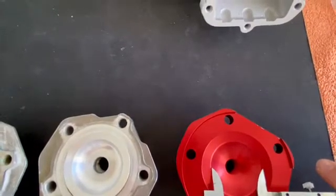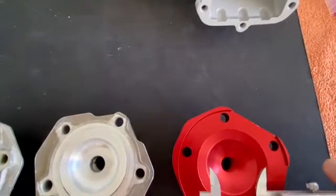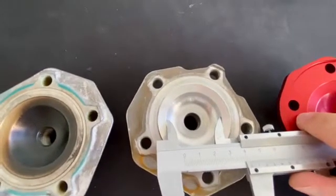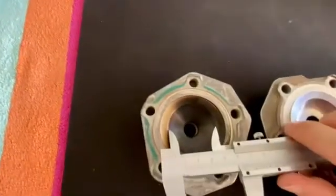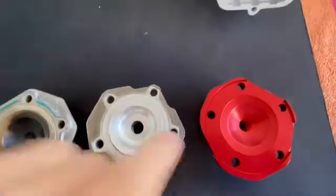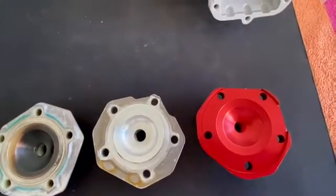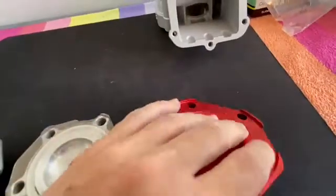The inner dome of the other two has been increased a bit. This is 40–41mm, and it's exactly the same as the 125cc on the RTT, and probably the same as the original. So really, what you can say is that the main difference in the shape of this head is the squish band. I'll measure later — it is actually the ratio that is probably too large.